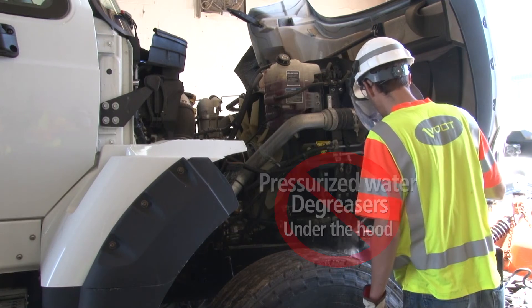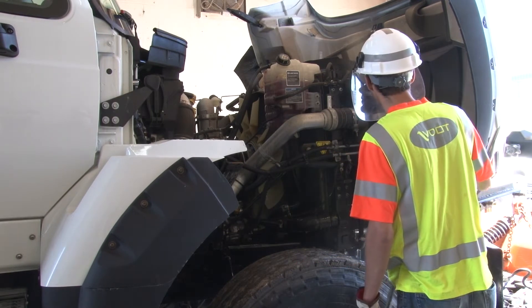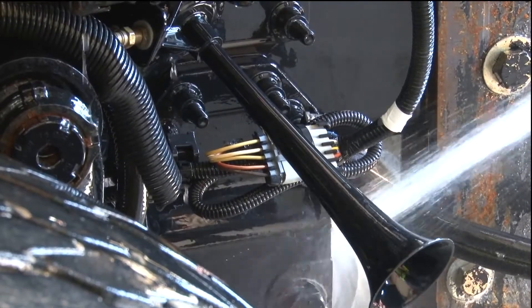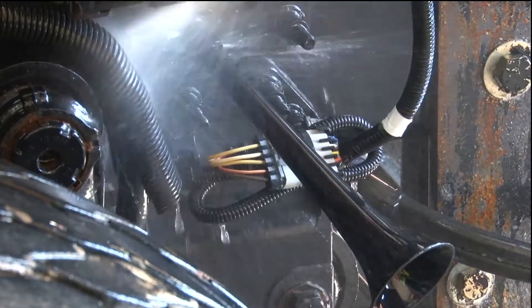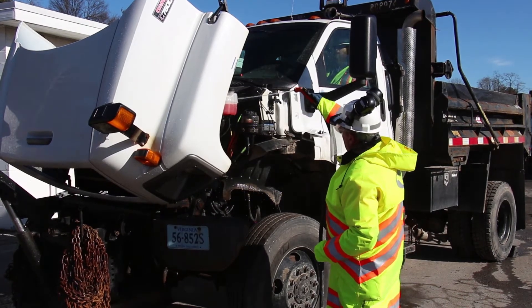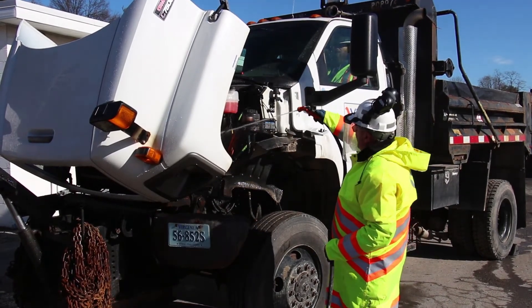Electrical wiring harnesses and components like lights, fuse boxes, and heated mirrors can be very susceptible to corrosion. Take special care to desalt them, and special care not to force water and salt into the wiring connections.